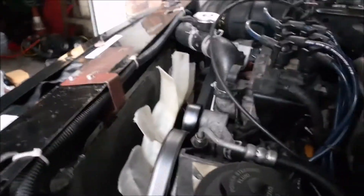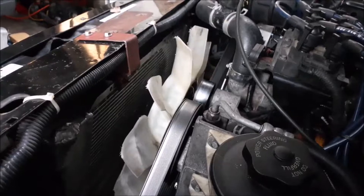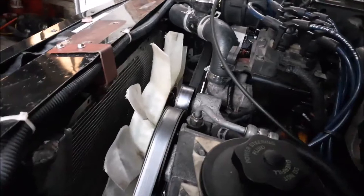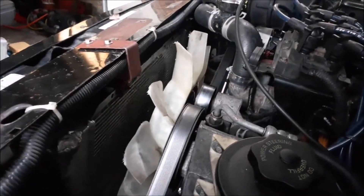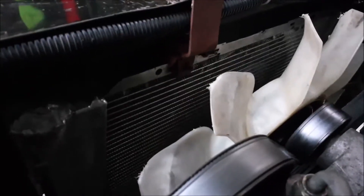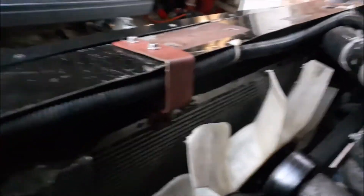The issue was I ended up having overheating problems because I originally threw the fans on the condenser and didn't realize there wasn't enough airflow. So instead we hacked up the lower support and got rid of it. We ended up putting in two SN95 mounts on the bottom — got them welded in — and then I had an original Fox body Mustang mount for the upper, which was a U-shape with two riv-nuts.